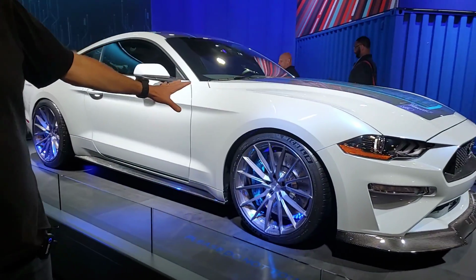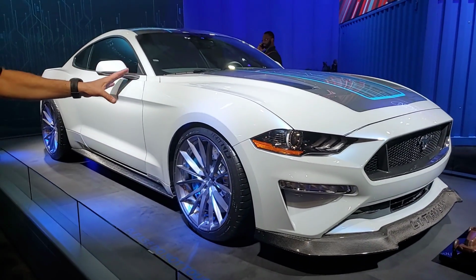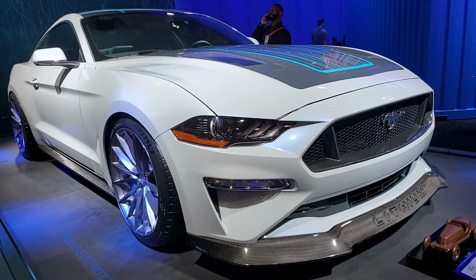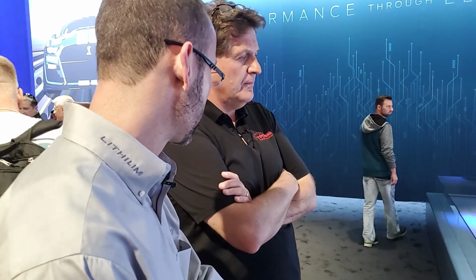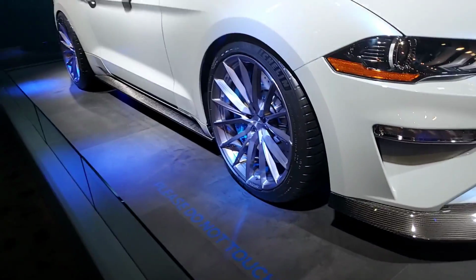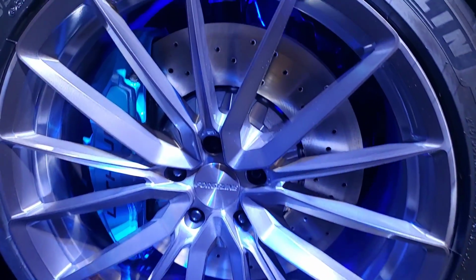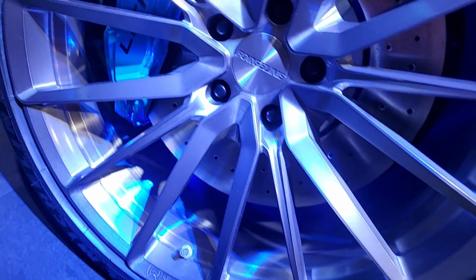All right, well, let's look at the reason we're here. Let's look at the Mustang. So you guys built this, well, not from the ground up, but in a way it's harder to take an electric power plant and retrofit it into an existing car, right? It is, yeah, because this was built for a gasoline engine, so you have space where the fuel tank was. You have space where the exhaust was, but you don't have that flat floor like you would in a vehicle built to have batteries at a lower center of gravity. So we've spent a lot of time packaging. We built this car 3 times digitally in CAD before we ever tore it apart, because you have to have the batteries where they need to be, and we wanted to maximize power, but also watch weight, so we didn't have a car that was too heavy.